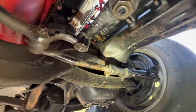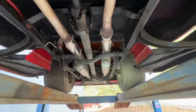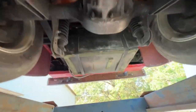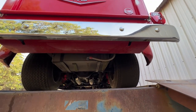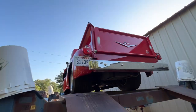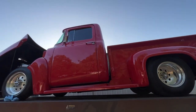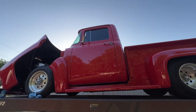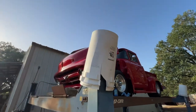I believe that was the main items that I saw on my inspection list on the truck. The door handles, again, are still continuing to be problematic on the inside door handles. They're so heavy, and when the door gets pulled or slammed shut, that weight just pulls those little Allen sets right off. So probably need to come up with a different solution on it. Maybe a lighter door handle with the correct spring clip on it will retain it a little bit better. I'll check and see if I can research anything for a solution quickly that we can add to it.